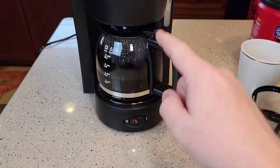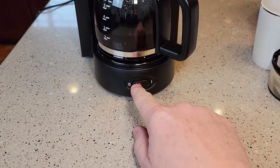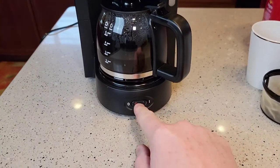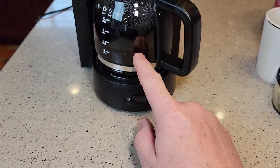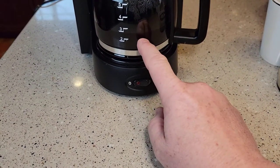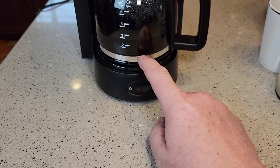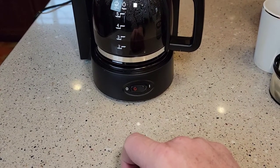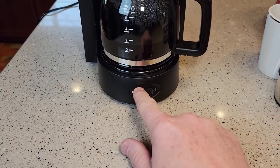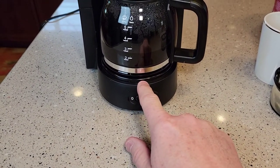Here's something you have to remember: when you're done with your coffee maker, you've got to turn the switch off. There's nothing automatic about this coffee maker. If you don't turn the switch off, even with coffee still in there, it'll heat that up, the water will go down, and you'll get burnt coffee in the bottom of your pot — and it could crack your pot. So when you're done, make sure you turn it off to shut the warming plate off.